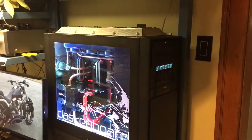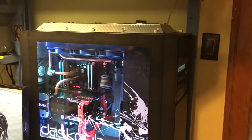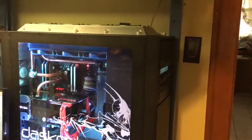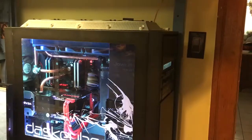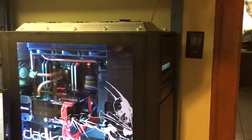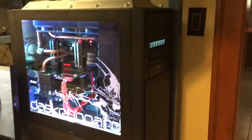There's an added fan shroud on top. Originally I had a 480 Monster which is 80 millimeters thick, and I had to go with a UT60 to be able to do what I wanted to do with this bend on top. I wasn't able to do that with a Monster because of clearance issues.